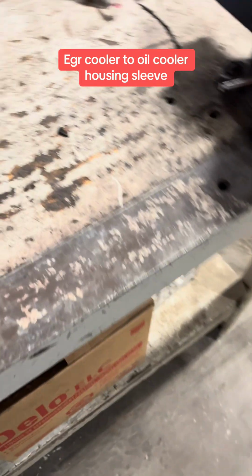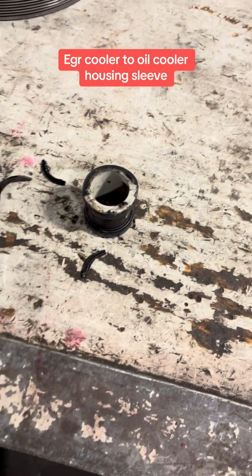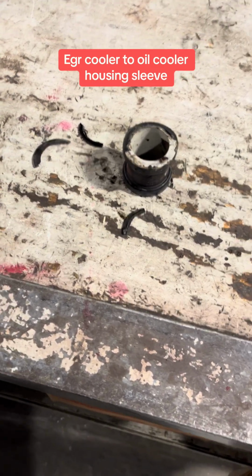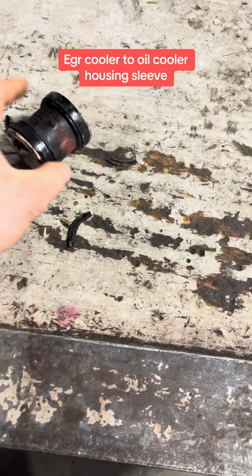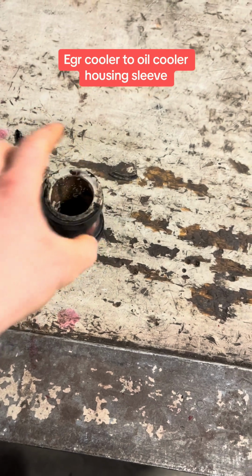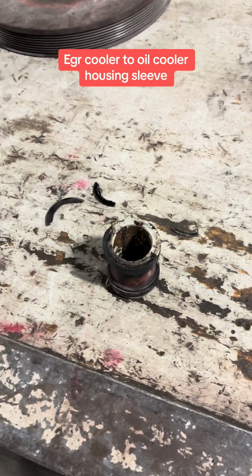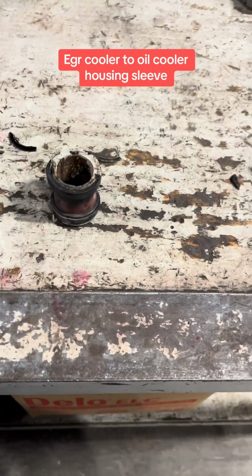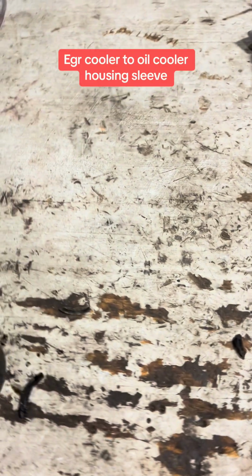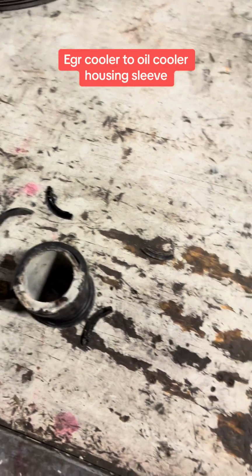And then it's hard to see it, but you have to go in there with the blower, blow all the stuff out of the way while still holding the pressure. You get a mirror. You're gonna come from underneath this guy with the mirror, okay? And if you have your mirror right underneath it, it's actually gonna drip on your mirror, the coolant. And then you know for sure it's not coming from anywhere else. But the job itself ain't too bad. It's on a few of them.